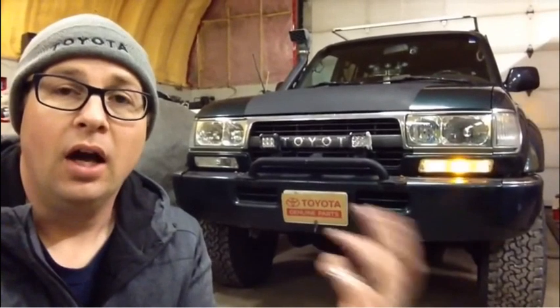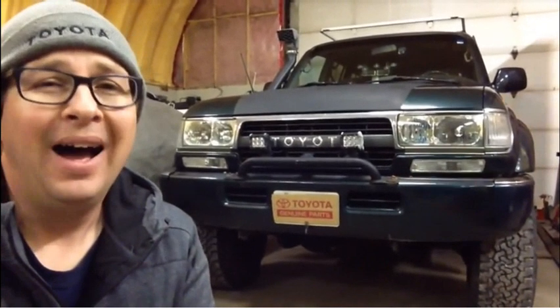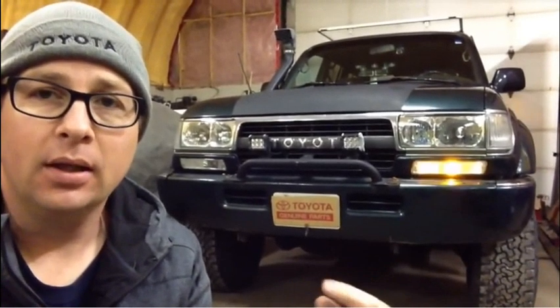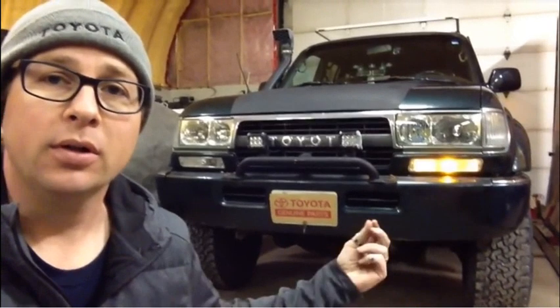As you can see right now, I have my four ways on and my right turn signal is not turning on. I can't tell that from inside the truck because my flasher rate stays the same. I've seen that I have this bulb out, and what I'm going to do is split the circuit in half — start in the middle. I don't know if it's the bulb; I doubt it's the bulb because it's LED, but I'm going to take the bulb out and see if my test light lights up. If my test light lights up, I'll figure it's the bulb. If not, I'll slowly work backwards until I find where the problem is occurring.